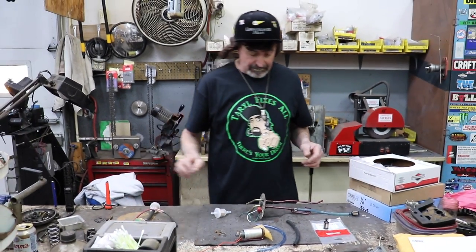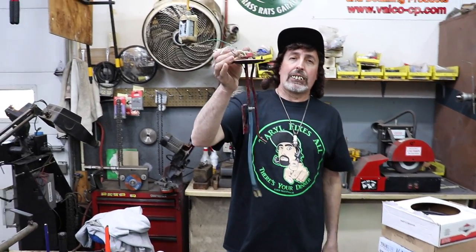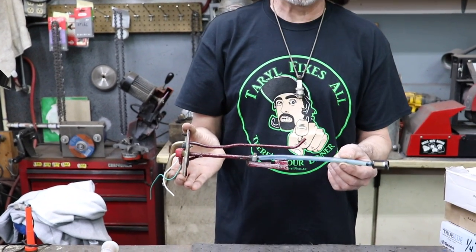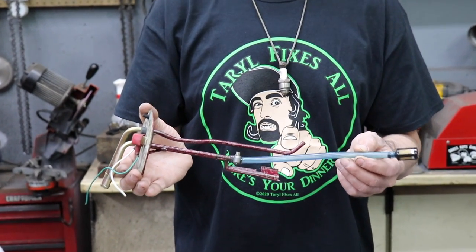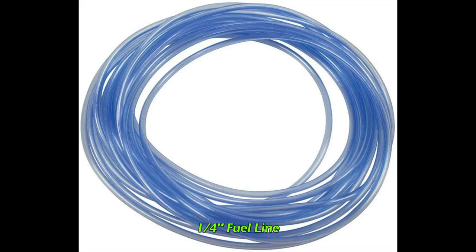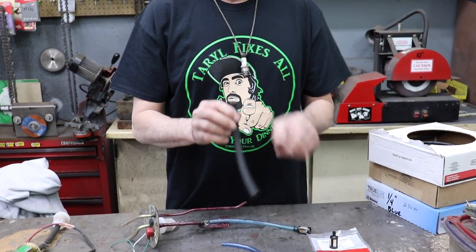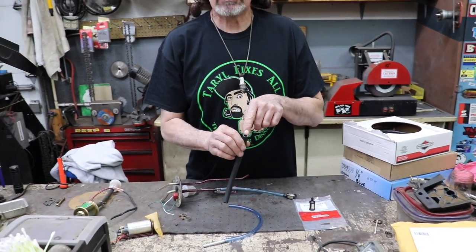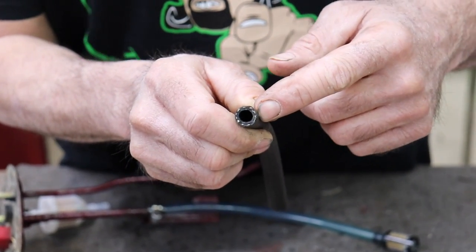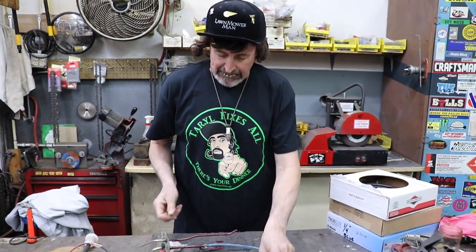So I'm going to show you how to do it. You remove the old fuel pump off the tank unit that goes inside the tank, and then you're going to want to get yourself some of this — either yellow or the stuff I use called True Blue from Stens, since I'm a Stens dealer — but you can get that kind. This is quarter-inch fuel line. You want to use the clear plastic-type fuel line; you don't want to use rubber quarter-inch fuel line, because the inside of rubber fuel line has two layers — the inside is a different rubber than the outside.